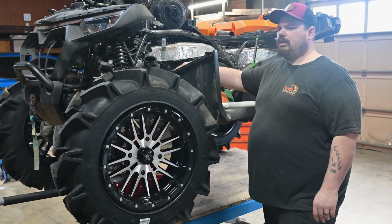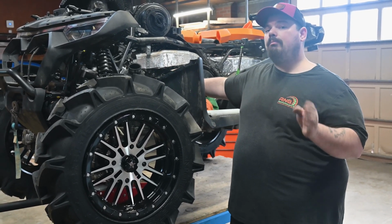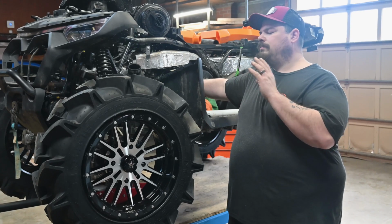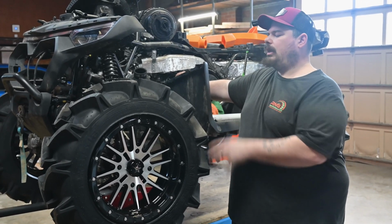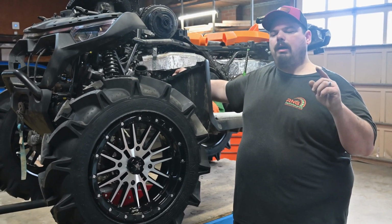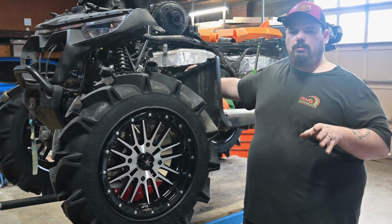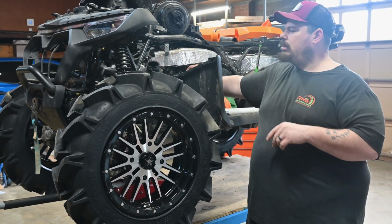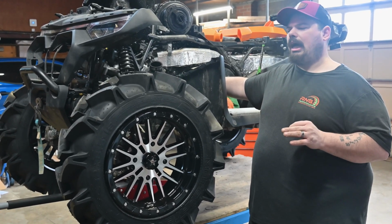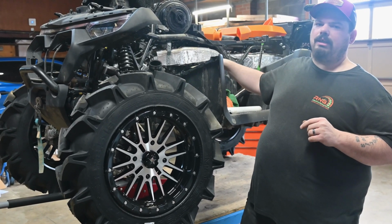What happens with the OEM belt is they use a really crappy brand belt in this model, not the other models, and it does slip quite a bit. That slipping does go away quite a bit with our clutch kit, but that belt is not that great. So we've been working with Mitsubishi to have an upgraded belt made for this. We have testers all over the world testing our belts right now. We're not taking any more testers. We've been testing for over a year, everything has been going smoothly to plan, and they are in production and will be ready for sale in July. Definitely get one of our belts, especially if you're doing this, because the Bando belts in here are not going to take it.